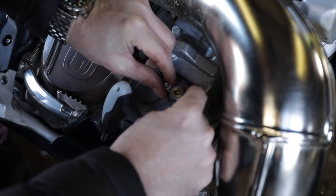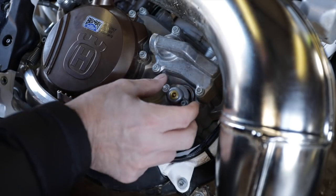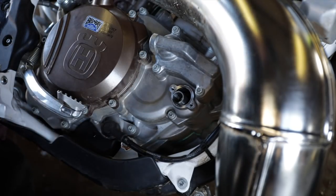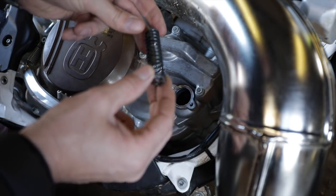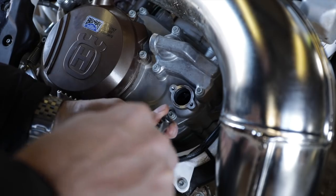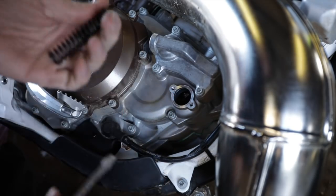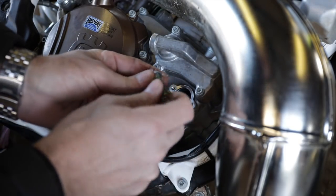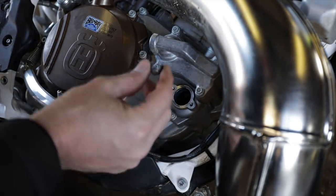I finally had to break down and order a torque wrench. I think I used to have one — I think it got stolen. I had a shop years ago that got broken into. So if we pull this out, this is not the spring in question — the spring in question is inside there. I can see that indeed it is yellow. So we'll pop that keeper off right there. This is pretty simple. I think any shade tree mechanic should be able to handle this job. There's the yellow one — it just sits in there. So let's put the old man spring in.